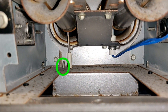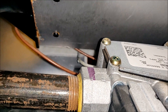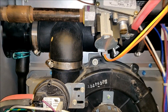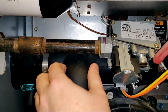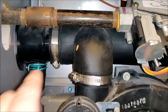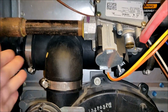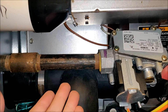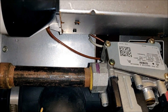You can actually see the head of the screw sticking up that is holding the flame sensor in place. We need to get underneath to undo that screw and pull out the flame sensor attached to the white wire. The easiest way to access that area is to remove this chunk of flexible rubber tubing, which is held on with standard radiator clamps. We'll unscrew all three radiator clamps enough to loosen them, work this whole piece out, shift it off to the side, and that gives us a lot more room to get in with a screwdriver or socket to remove that screw.